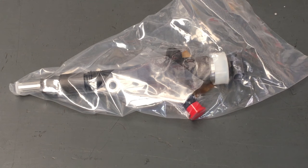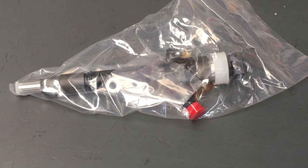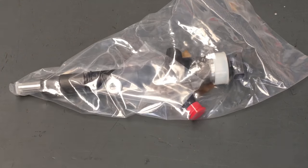If you've got a 2006 vehicle, it's 2020 now, right? So things are a lot better. So these might be 0.02% out, so it really doesn't matter. But what matters is if you've got an 06 vehicle, and those old injectors, they were 4% out. So you're obviously telling the ECU it's over or under, whatever the case may be, by, say, 3%. I'm just giving you examples here, right? So it's adding in 4% more fuel. I'm not saying that, I'm just giving you an example, right? 10%, whatever you want. And then this injector is the opposite, right?